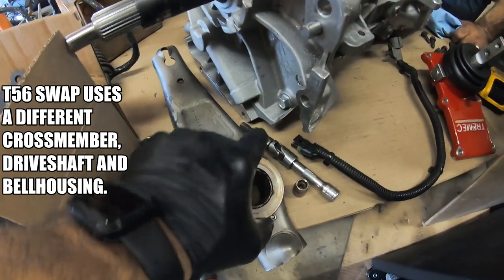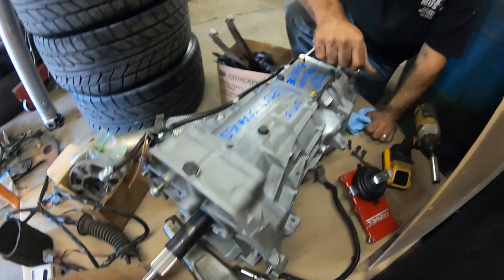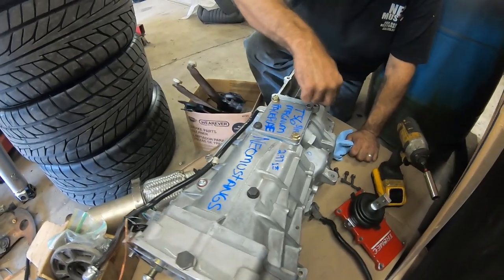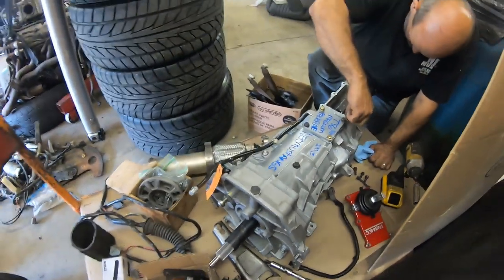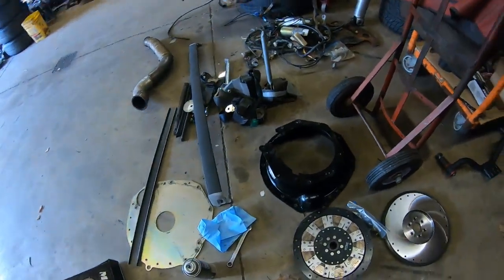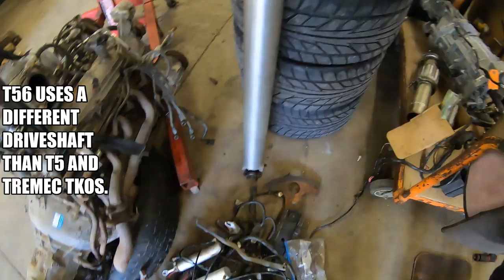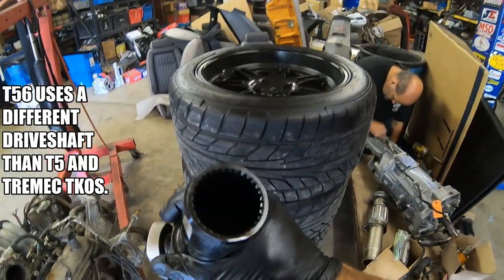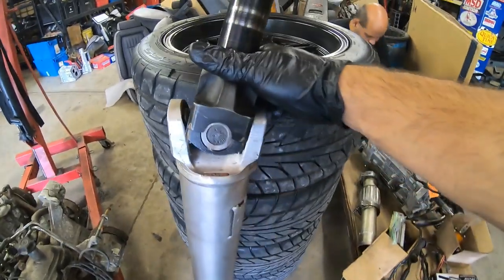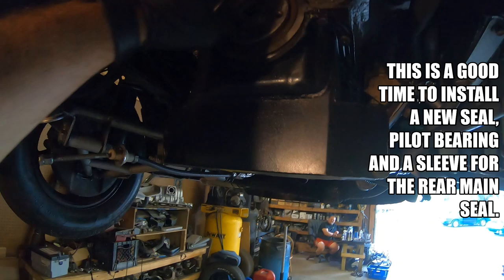This is actually an SN95 fork with the weight removed. We're going to stick this shifter on and put some grease on it. This is my adjustable nut. It does take a special driveshaft — here it is on my wheels. This is a special length driveshaft for the T-56 swap with a forged yoke, because I've bent like three of them already. First things first, the pilot bearing is good, so we're going to get the block plate and flywheel set, then the clutch.